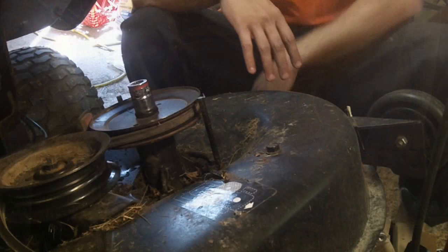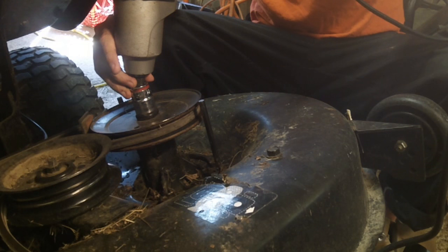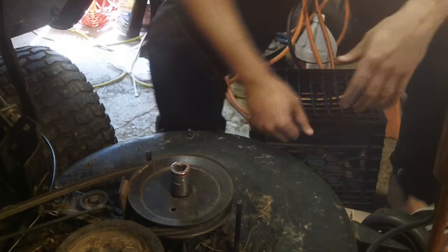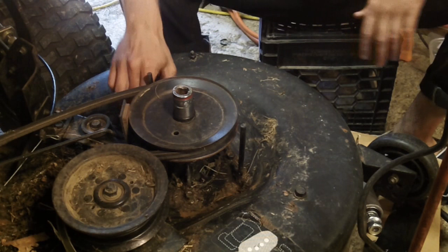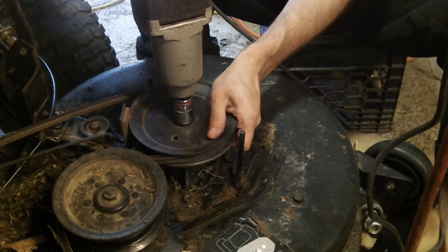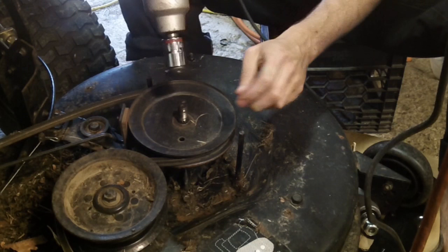Now let's move on to actually getting the spindles done. We're going to work on dropping out our spindle using the electric impact. For this we're going to need a 22mm and a 13mm socket. All we had to do was put the deck release down to the lowest position so the impact could fit. If you're doing this by hand, you probably want a pipe wrench or chain wrench for the pulley. If you're doing it with an impact, you should just be able to hold on to it.